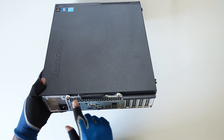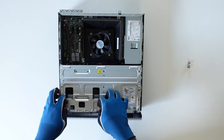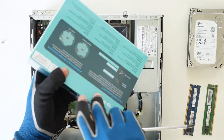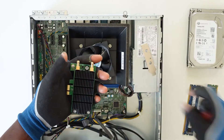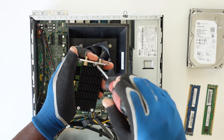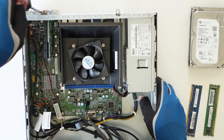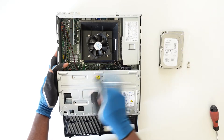There were two screws behind the PC I needed to take out in order to access the inside of the PC. I took up the wireless LAN card — it's a new card and pretty much had all the accessories I needed. I took out the full profile bracket that the card normally comes with and screwed on the small form factor bracket. Thereafter I slotted the card into the PCIe slot of the PC, and the card was ready to go.